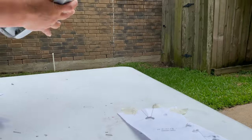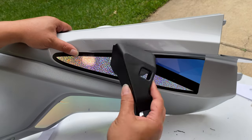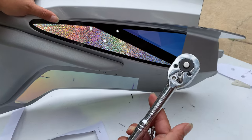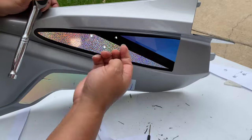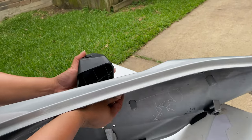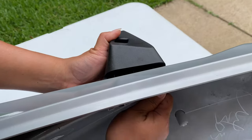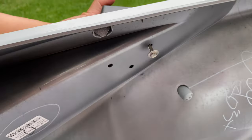We're done drilling the holes, so we can rip the template off — we won't need them anymore. There you go, you've got your holes. We've got our pieces here; now make sure they're lined up perfectly, which they should be especially if you used the template. Remember, you have a socket wrench with a hex socket — I'm using a 5/16. The screws already have a built-in washer, so put them in by hand first. I think the quarter-inch drill was great.